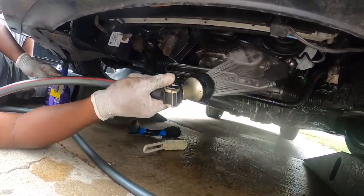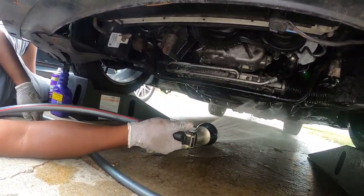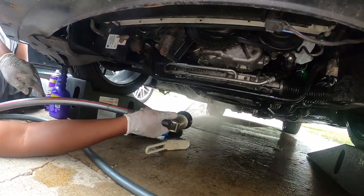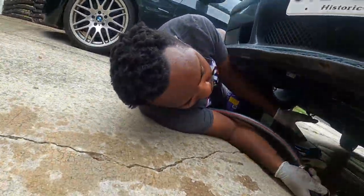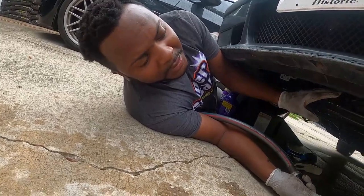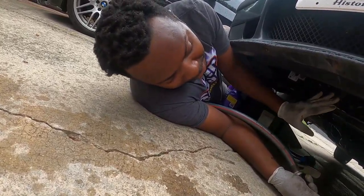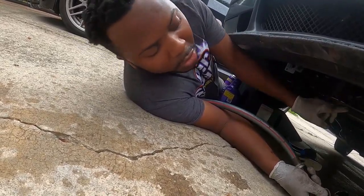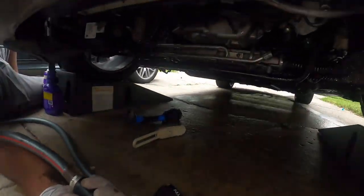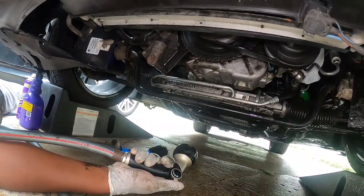It's looking better and better. It's not the best job, but it's getting there. You definitely need to agitate if you have a lot of grease like this, and you'll need plenty of product. Because it's raining, I'm going to finish the cleanup another day with sunshine and show you guys the finished product. The procedure is the same: spray, agitate, and rinse. Super Clean works — look at this steering rack, it was filthy.